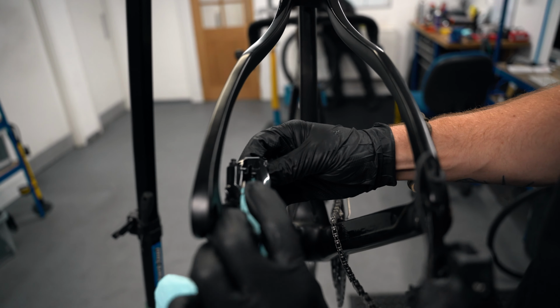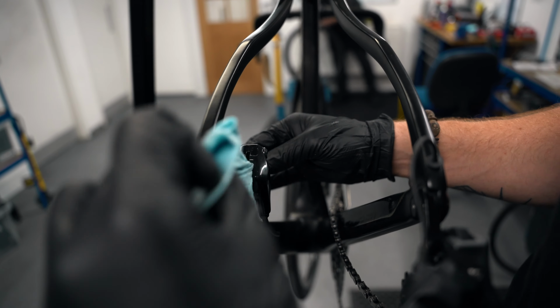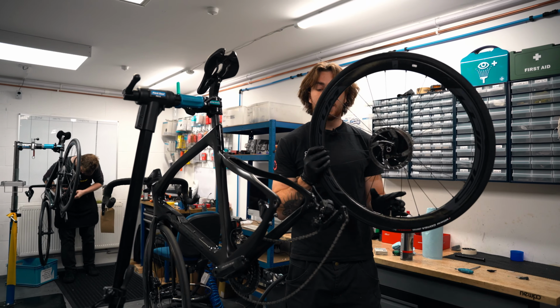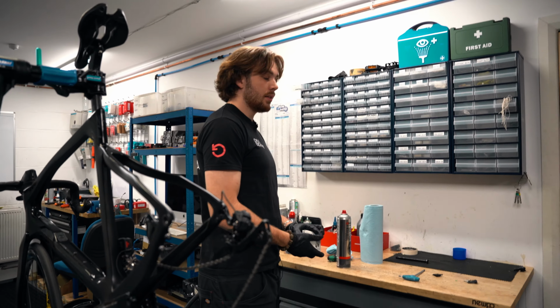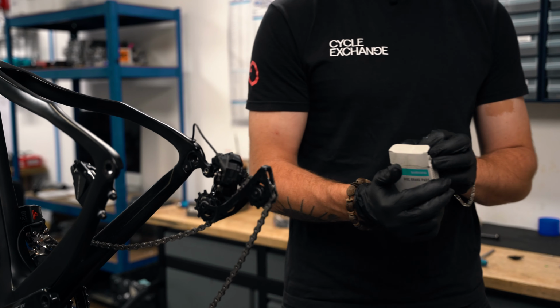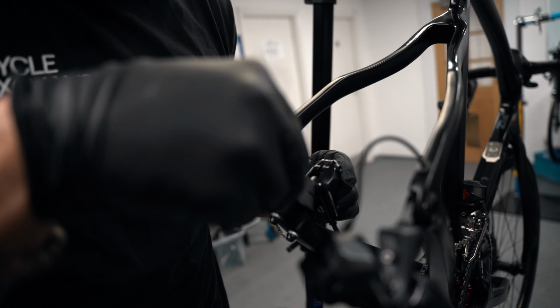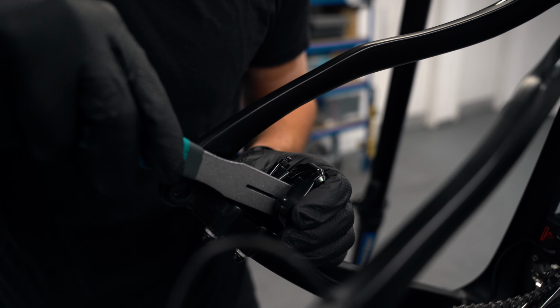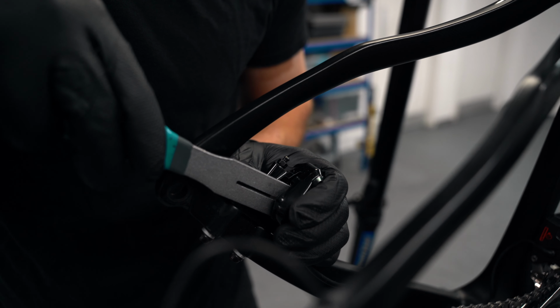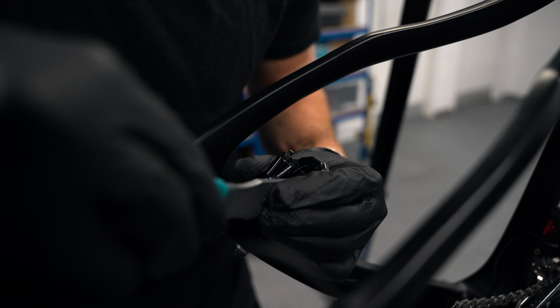Push a little bit of blue roll in the middle there and get the old flossing action going, right? We got a clean caliper, clean pistons, clean disc, and brand new brake pads. Cool. And what we're gonna do is we're gonna push the pads back, right? Really gently. You don't wanna crack a pad or anything like that. We're gonna get in there and just gently use it just to push those pistons back into their space, you know? Just so the wheel goes in there real nice with those fresh brake pads.